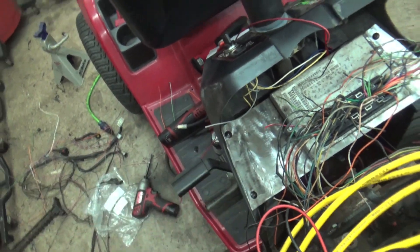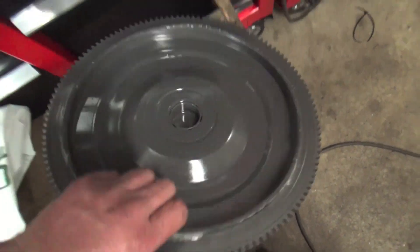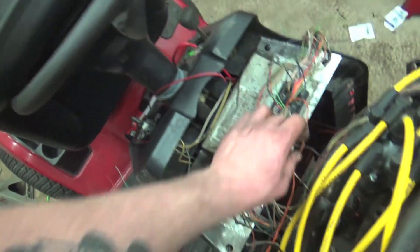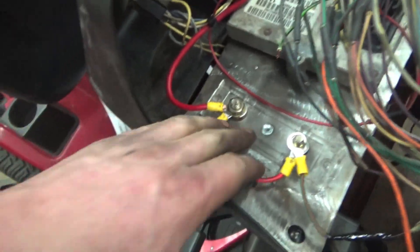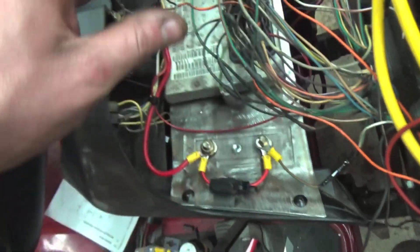I want to get a fuse bar here eventually, but for now we're just going to wire into this — I want to hear this thing crank over. The torque converter is all cut up and painted, nice and thin so the starter can actually hit something. I'll show you guys the wiring for ignition power, constant power, and grounds for our ECU. This is a 30 amp fuse for our fused ignition power to our ASD relay, to our PCM, pretty much everything. This is controlled by the solenoid down there that has constant battery voltage until you turn the key on, then it gets battery voltage to that yellow wire, comes up here, and gives power. This 30 amp fuse feeds our ASD relay and the PCM.